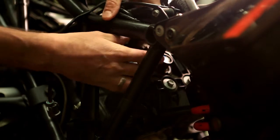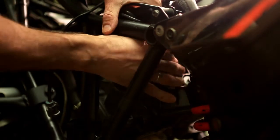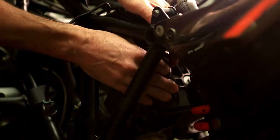You've got your two plugs there — take out the connectors. Then wiggle the ignition coil around to pop it out. It's a little bit sticky, so take your time.